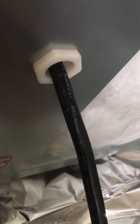This baking oven's 3-pin plug and wires get overheated and hot when used for a long time. The wire used for this oven is 3-core 1.5mm, and now let's change it to a 2.5mm wire, including the 15-amp plug.